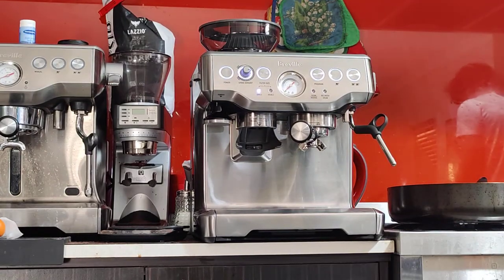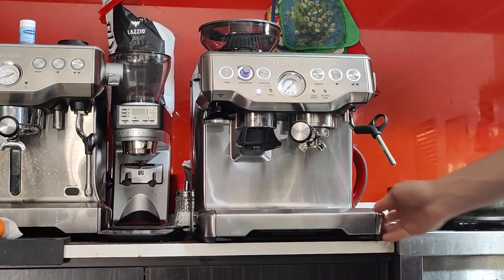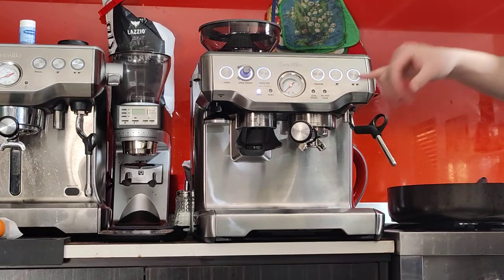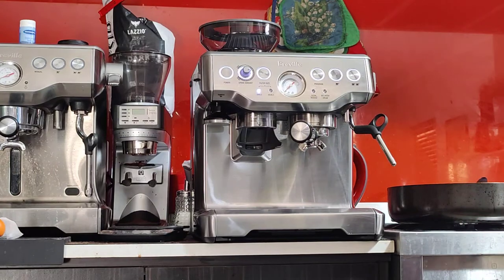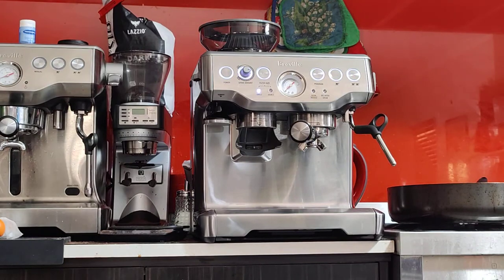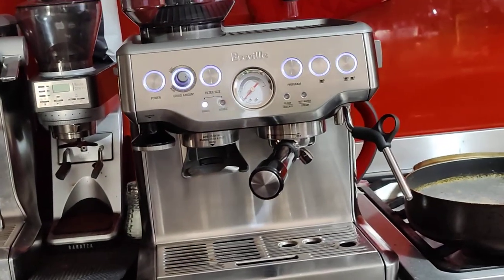That's all I think — fantastic machine, I'm sure you'll love it. It's important to use good beans and to keep up with maintenance: mainly changing water filters every three months, doing the clean cycle and descale cycle when it prompts you, and keeping the machine dry. Any issues, just let me know — I'm more than happy to help. It does come with a one-year warranty, which is good peace of mind. After the warranty period, if you notice any weird noises or leaks, feel free to message me. But for the meantime I think you'll love the machine — it won't give you any troubles anytime soon. Thanks for watching, see ya.